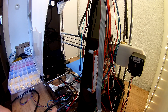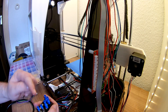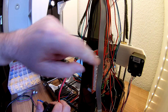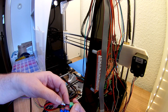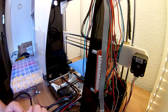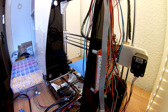The power cable — the big one here — I take out completely, because that is connected here in the future. The cables from the power supply to the remaining parts I exchange. For this I bought these thicker cables. The power cable to the motherboard must be maintained, of course, because the motherboard must still be supplied with power. I'll see if I find better cable lugs for this cable, because at the moment the cables are screwed directly to the plug. The cable is thick enough for the power supply of the motherboard, so it does not have to be exchanged for the MOSFETs. I will make from these cables two connections and then connect them to the power supply, so that I can supply the two MOSFETs each individually with electricity.